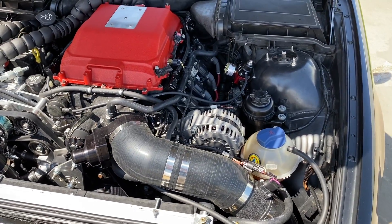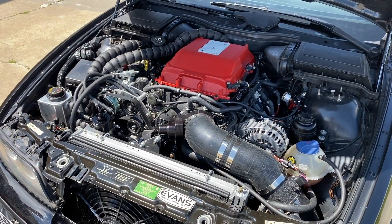I really wanted a five-inch intake tube but there was nowhere to put it — I barely got a four-and-a-half-inch tube in without it rubbing the hood. The supercharger is completely ported: the body has been ported, the runners inside the supercharger body were port-matched, all the bosses where the fuel injectors reside were bulletized to reduce turbulence in the intake before it enters the heads. The entire snout was opened up to 102 millimeters — you can shove your fist down it — so it can really breathe.